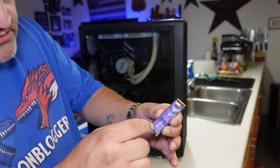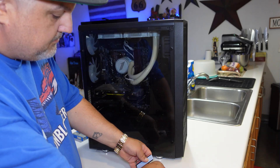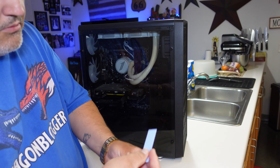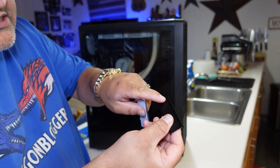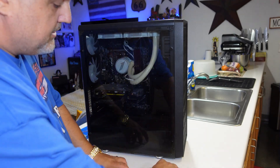This is going to be the gold pin side, and this is going to be the side you screw. It does come with the heat shielding and thermal pads. You're going to stick the thermal pads to the M.2, and then stick the plating in between to sandwich it. It's got finning, and the finning is going to allow it to cool. The thermal pads help conduct that cooling.